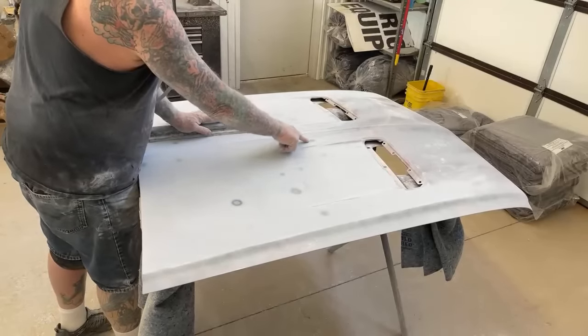I try to use my bondo spreaders until you just can't use them anymore, and that's basically where this one is. Once again, when you put your body filler on - whatever you're using - always fill the center of your little dent or your big dent and overfill it. There are people who will tell you to add five or six thin coats, but you don't need to do that. So there are those right there, and that's what you would do on small imperfections - use this polyester glaze product instead of bondo.